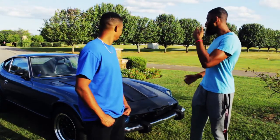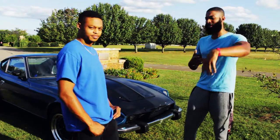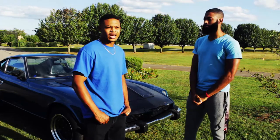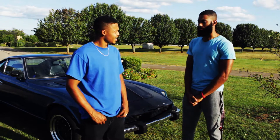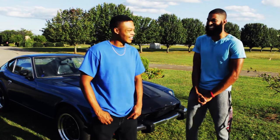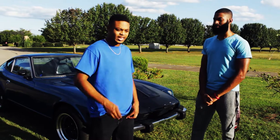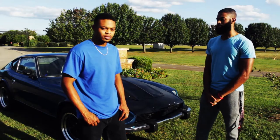What made you decide to go with the LQ9? The LQ9 is out of an '06 Cadillac — that's the donor vehicle. The reason I went with that one is iron blocks versus aluminum: first off, it's cheaper, easier to get your hands on, and they're stronger. People out here with 5.3s are making a thousand horsepower; you make a little bit less with a 6.0 stock bottom end, but I gave a little cash for the block and left the bottom end alone.